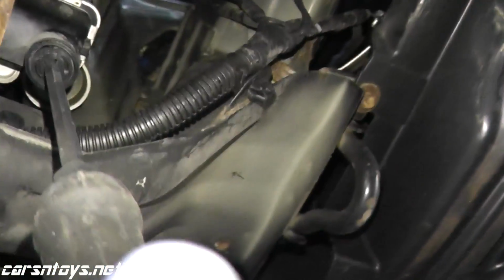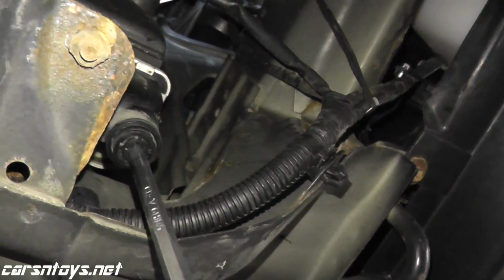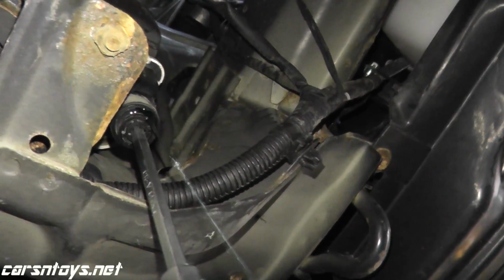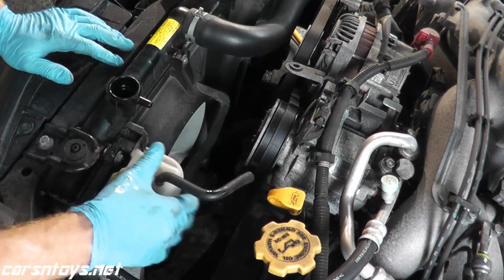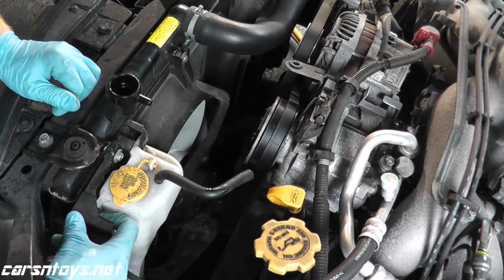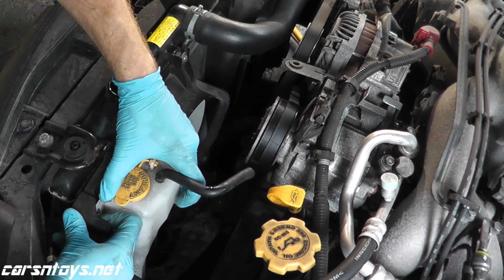Now on the right hand side of the radiator, that's the passenger side, you have a Phillips size screw. Just remove this screw and this will drain the fluid, okay? So now we're going to remove the overflow bottle, clean up the top so we can remove the fans. Right where my index finger is, there's a little clip. Just press in the clip, and this comes right out.